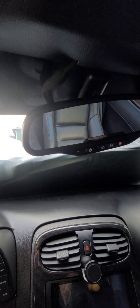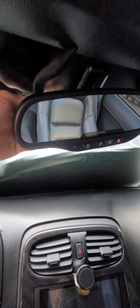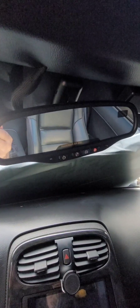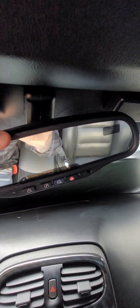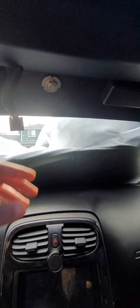This should just twist — be careful you don't apply too much pressure. If you feel like you're applying too much, back off because you don't want to break the windshield. I've done that before and it's not fun. Do more research and make sure you're doing it right. Grab from the top and bottom of the mirror, apply a little bit of pressure, and you'll see it starts coming off. Make sure it doesn't hit anything up top — gives you more space — and then it'll pop right off. Not gonna lie that was hella scary, but we got it off.